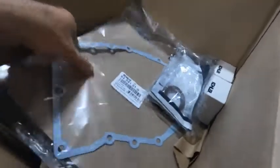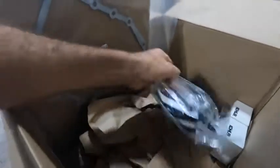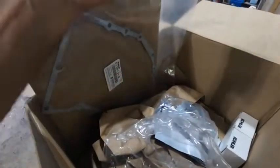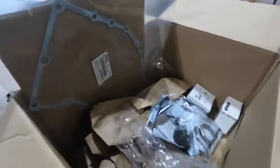I went ahead and ordered a whole bunch of stuff that is typical that you're going to need — like new crankcase cover gaskets, since that outer half of the engine is coming off, new crank seals, and here's the governor itself. These are literally plastic, and the little weights fly out on it. What happens is these shear and they fall apart. Hopefully things just fell right down the oil pan because we're banking on this being what's wrong. I also got a new crank bearing and an oil pump since we're in there.